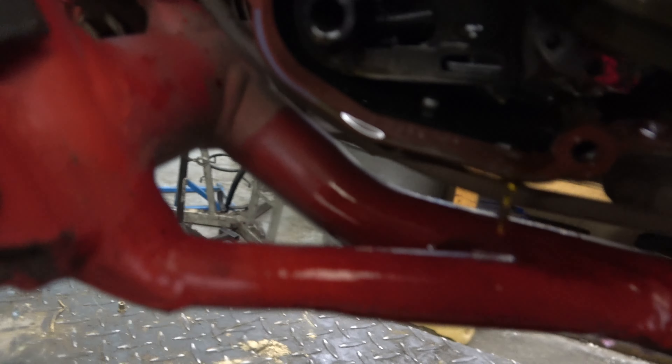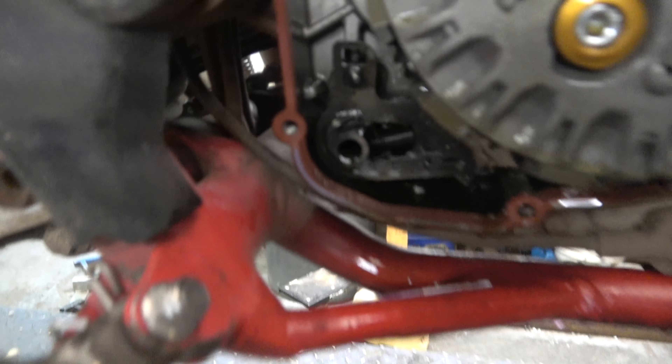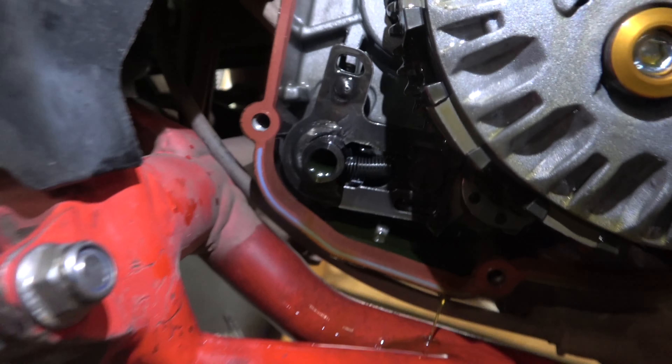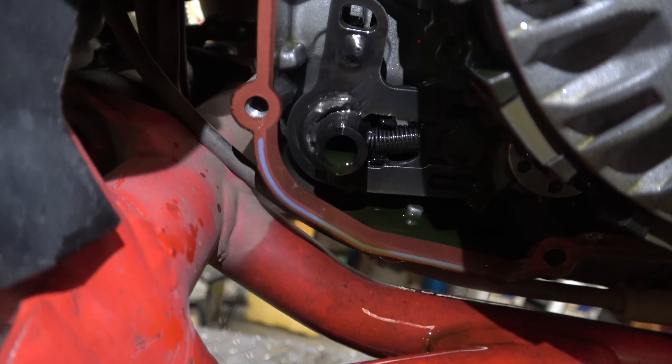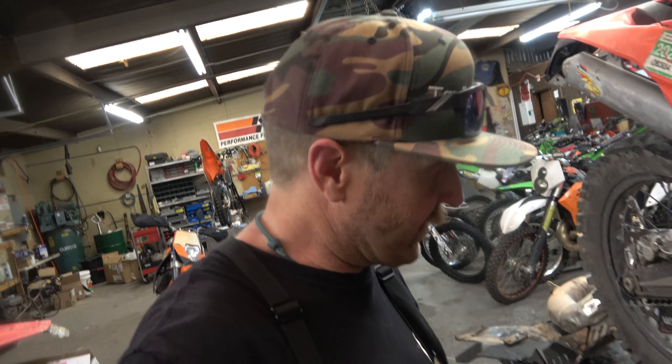Alright guys, I figured it out and it's what I thought it was. You can see the weld is broken - no shifty anymore. That is the second one of these I've seen on a Beta. Also, a couple things I just think are ridiculous about this Beta - people always ask me why don't you ride a Beta, well here's one reason: one of the power valve cover bolts is a security bolt. Also the water pump is a separate thing - I guess maybe that's cool if you want to, but no one else does it like that and it seems ridiculous. This is the second broken shift shaft weld I've seen - first on an X Trainer, the other was on a 300RR.